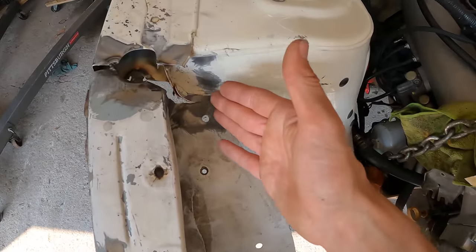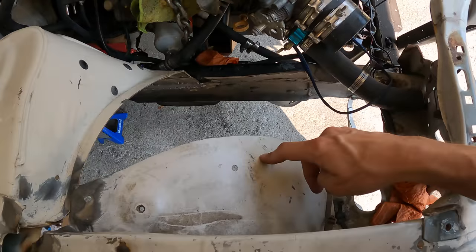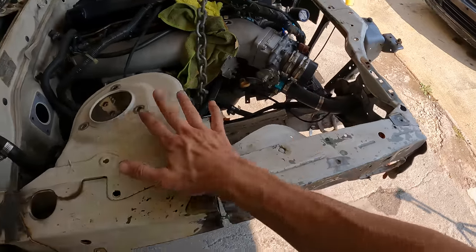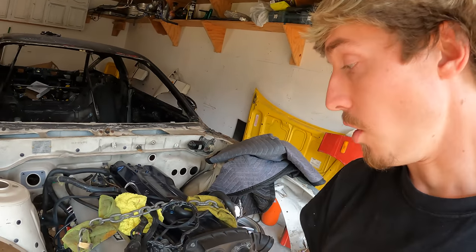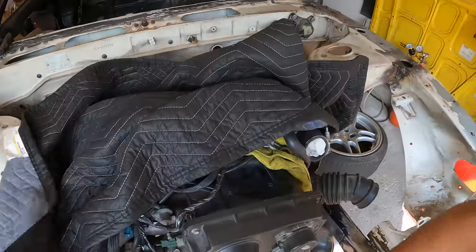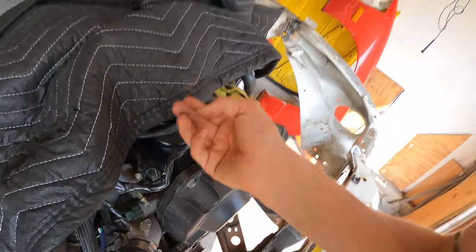First thing right off the bat, I'm going to start by trimming back the rest of the stock fender well, because we don't need this. And while I'm trimming that up, I'm also going to weld in some caps here so that the core support can be fully attached to the shock towers, because all of these dimensions have been figured out in previous videos. Before I weld or grind, I always fill in all of the open holes with towels or something so that no debris gets inside of the engine. Then I'm also going to cover it with this moving blanket just to be extra cautious — the last thing you want is a weld bead flying off and melting a wire and then chasing electrical issues later.